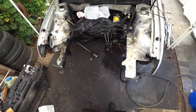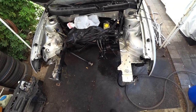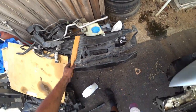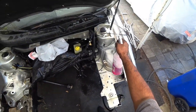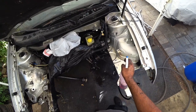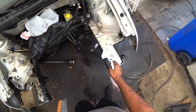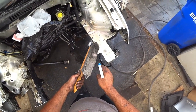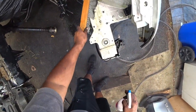So if you're feeling up to it, the next step is to grab a brush, soak it in Purple Power, and start scrubbing. If it's wet, Purple Power won't stick to the actual area, especially if it has grease on it. I know it's kind of a weird thing to say, but it just falls off. It runs instead of staying and doing its job. So get a brush that isn't soaked in oil.